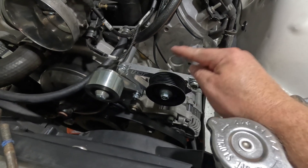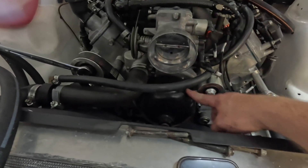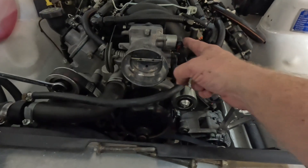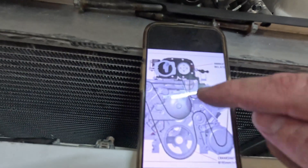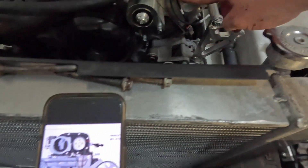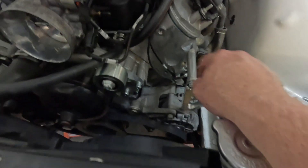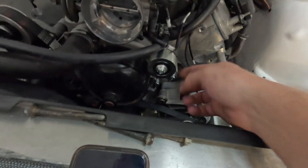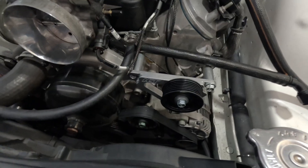This one I need to run — I'll have to sort out something else that doesn't use these mounts. The purpose of this pulley here is basically: the supercharger pulley is going to be up here somewhere, so the belt will come off the water pump, around the charger pulley, and down around this. The job of this pulley is just to increase the wrap on the lower pulley, back down here, then up over the power steering and down to the alternator.